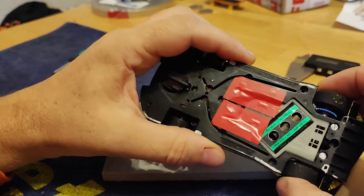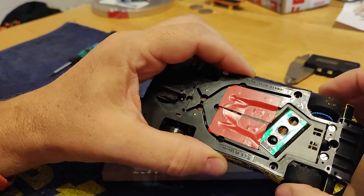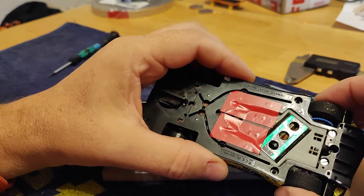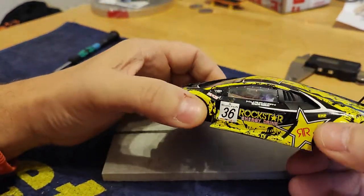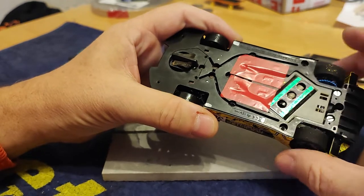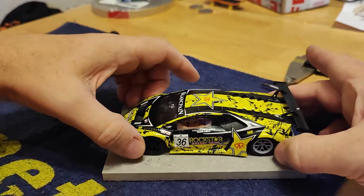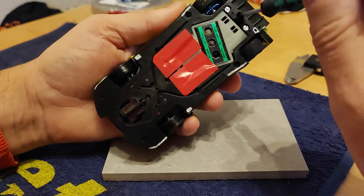One change we made during qualifying was to put some sticky tape on the motor pod here. This was to control somewhat the pod motion in the car, particularly the roll motion — a handling adjustment really. We found that when the car got to the limit and swung the tail out, it would go pretty big and pretty violently. When we did this additional taping, we found that the car would stay flatter in the turn, handle a little bit more consistently, and when it let go, it didn't let go in such a violent fashion. So we left it on and ran like that.